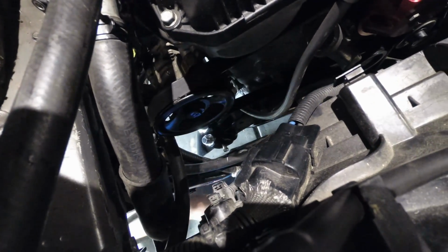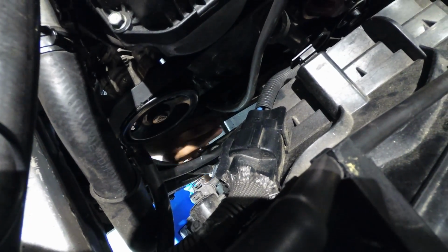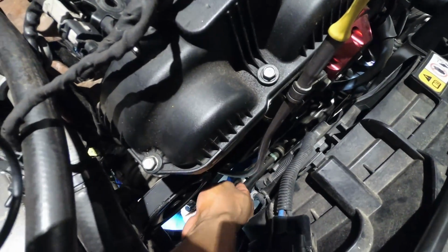So the oil filter housing is very simple on the 3.8s. It's 4 10mm bolts. Having a ratcheting wrench, like I said before, works wonders. You're going to snake your arm around, and you're going to take off the OEM bolts with the wrench. Crack them loose, and then you're just going to take them out by hand. And like I said, there's 4 bolts. That's all it is, and this oil filter housing will come out. And if you want to, you can actually remove it from up top here, by snaking your hand down here and doing that. It's really not that hard to do.